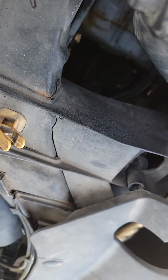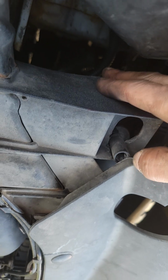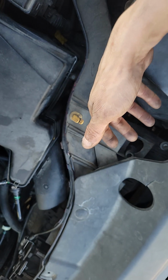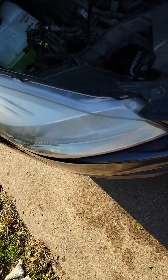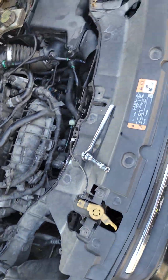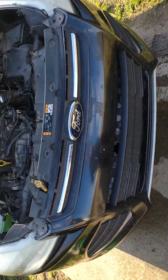The way I bleed the system, man, is there's a bleeder valve down there, or not a bleeder valve, but there's a hose connection for the upper line, and I just disconnected that, raised this side in so the air can get pushed up through this end. So it caused a vacuum. That's why you see all this coolant everywhere. But she got heat, man. When she's all back together, I'm gonna put these wipers back on, and we should be steady for ready.